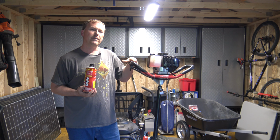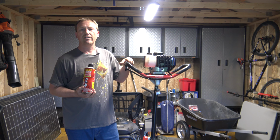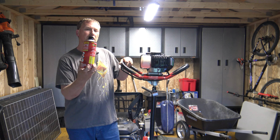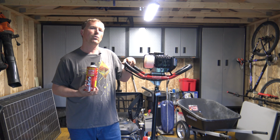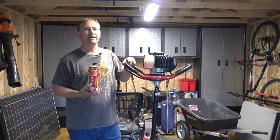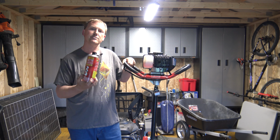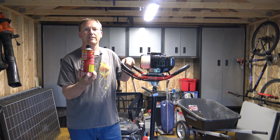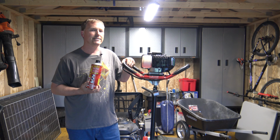Now I watched a lot of reviews myself before I purchased this last year. A lot of people had trouble starting it. They had trouble starting it the next year after it was sitting. All I've used is this True Fuel. And it doesn't matter if it's cold out, hot out, how long it's been sitting, 2 pulls and this thing fires right up. So I highly suggest you use an engineered fuel like this. You don't have to bother mixing it. You know the ratio is correct and it can store for a year and it's still going to start right up.